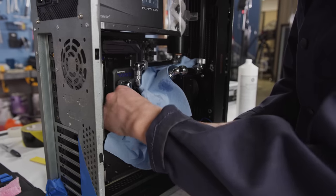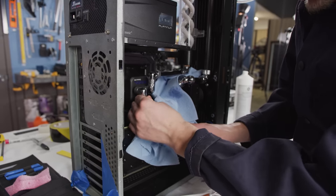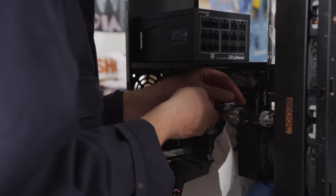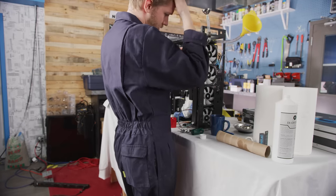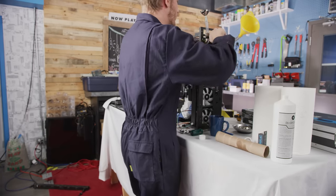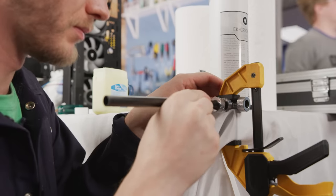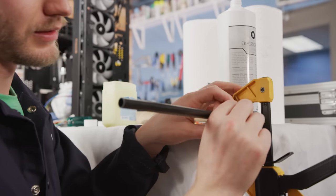So we're having a couple of problems there, the main one being that there are two O-rings in a fitting, and we were only getting through the first one. The second one, the carbon fiber was just a bit too sharp, even after being sanded, so it would either just hit it, or when it went through, it would just slice the O-ring to pieces and it wouldn't seal at all.